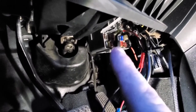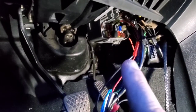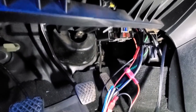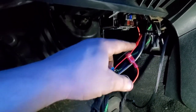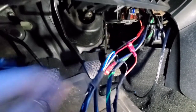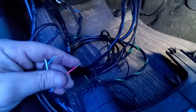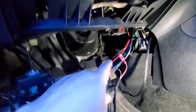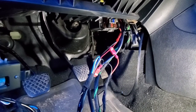You're going to use a tap-in that taps into the fuse box to hook up the power signal. What you're looking for is the fourth fuse over on the bottom — it says 'alternator'. You're going to use that one to tap into. Basically you tap into the wire that comes out and hook up your power that way. Every time you turn on the car it'll turn on, and when you turn off the car it'll turn off — that's the wire you want to tap into.